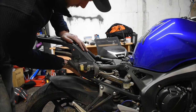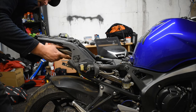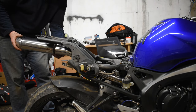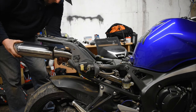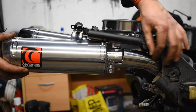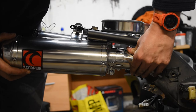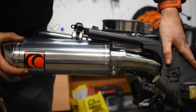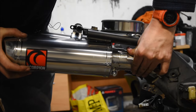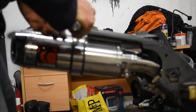Once that's done you fit the one-into-two pipe at the back, which allows you to fit your two silencers. They're really easy to fit — just push-fit with a single clamp on either side, and they also have an enveloping band clamp stainless steel thing that bolts into the supplied Scorpion rear hanger. They come with nice protective foam to stop them scratching your new exhausts.